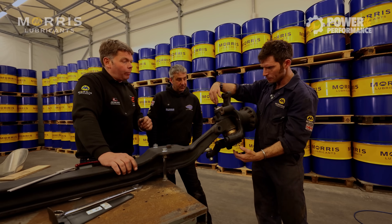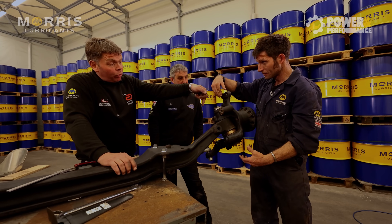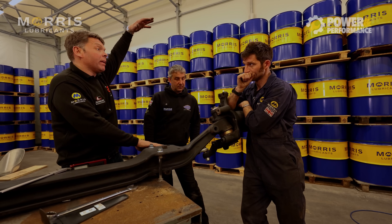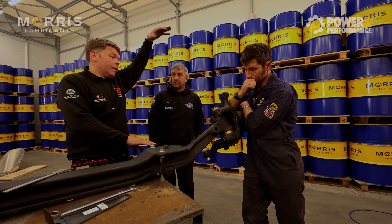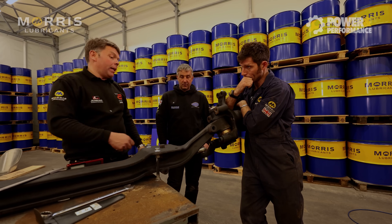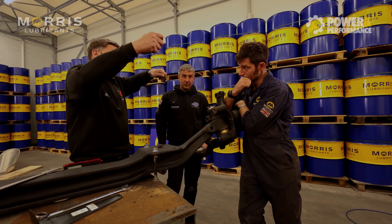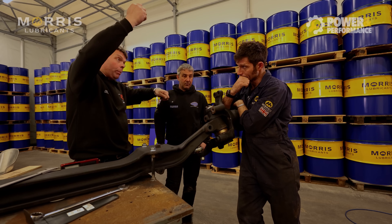So what are you using to twist? We put long kingpins in and strip it down. We need like a 50-tonne press to push the kingpins out, so we've got four-foot-long kingpins. We did this at ours — got it strapped down to a machine bed, got that bit cherryed up, and then a kingpin with a 90-degree bend and the overhead crane over the top of it and just pulled it.